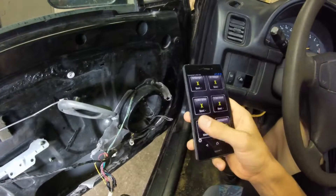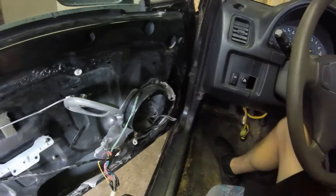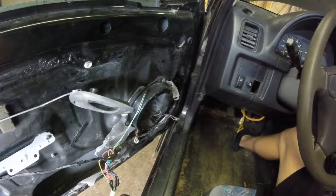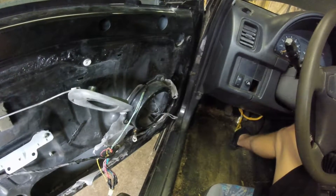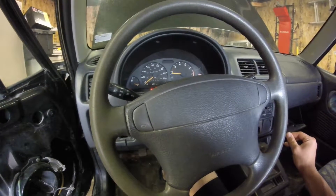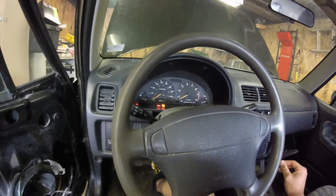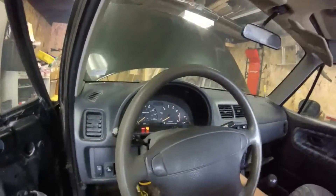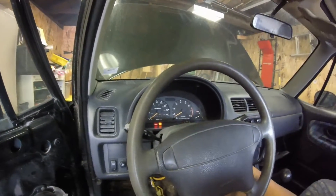We got a solid 13.7 volts at least. I'm just gonna give it some gas and see how it deals with it. What I'm going to try next is swapping the wires on the crankshaft position sensor connector. I couldn't really tell which wire went where because they were both cut when I got the thing. We'll see if that works out.